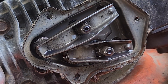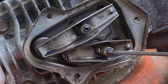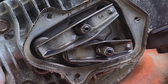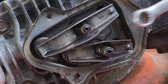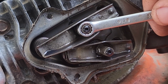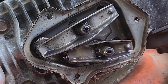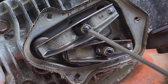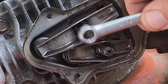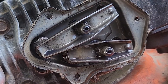With a nice close-up view, right here we've got a T10 torx head, and on the outside we've got a 5/16ths nut. What we have to do is loosen the inside and then turn this to adjust the valve in or out accordingly. Let me show you how that's done.